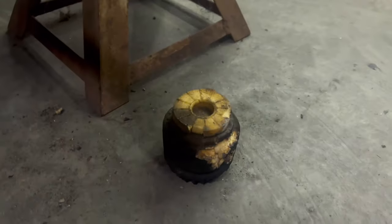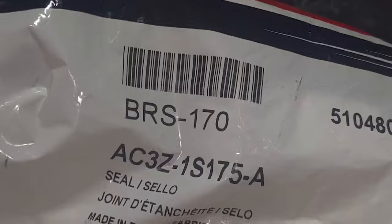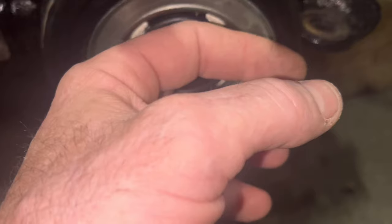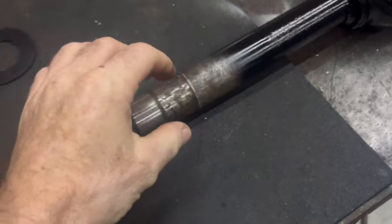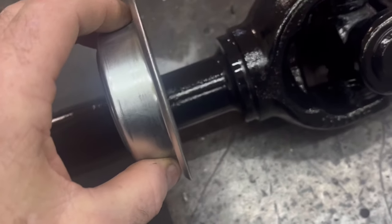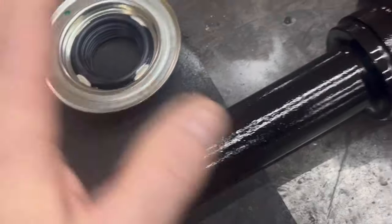They are commonly old — this would be a whole set, all four of them. Yank that off. This is the updated seal, the RS170 — it looks like this. Let's open it up. This little guy will get the call because it fits great — that ridge right there presses inside of that. See, it presses in there. It's kind of hard to do, actually. You really want to press this in before the axle slides in, but you cannot, because this is our axle right here — this guy will slide over the end of the axle and sit about right here.